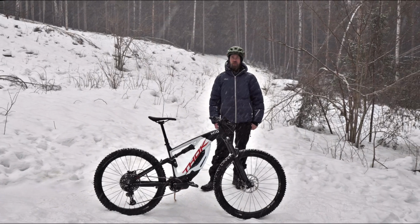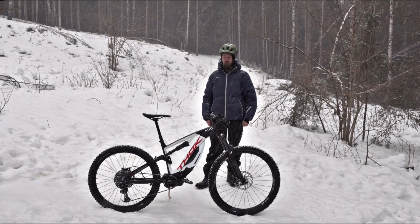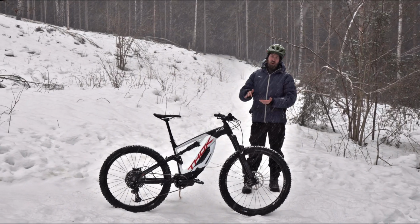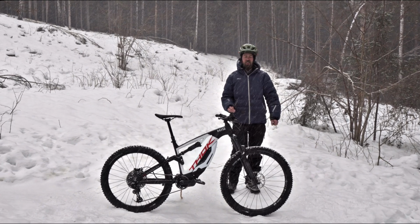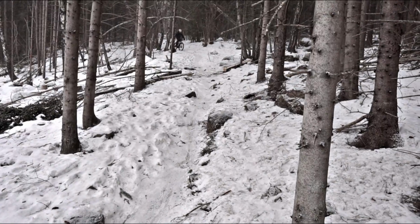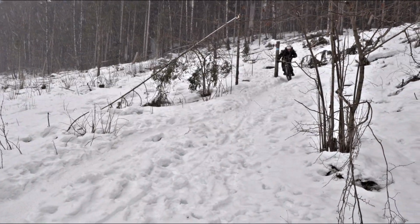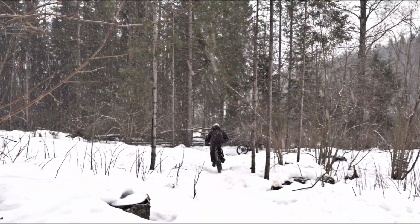When riding in snow and really cold conditions, we've had minus 10 and below for weeks, and sun, but not today. When riding in such cold conditions, the suspension oil flows through the shim stack like syrup, and the grease on the fork has the consistency of cold candle wax. So it's not really easy doing a regular test of this bike in these conditions. We just wanted to have a look at the bike, introduce it, and see what it's all about. And we think it's an interesting bike, mainly because of the price.